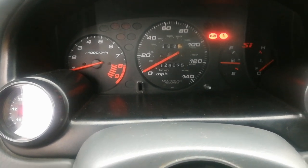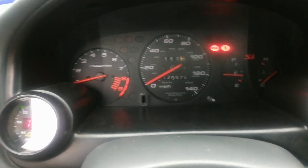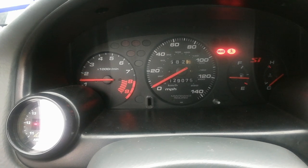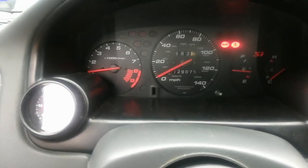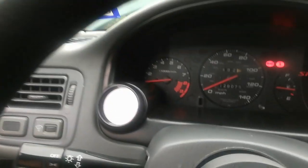Notice how now it drops down really fast. Let me get a little situated in here. I'm gonna tap the gas and it comes back really quick — well, quicker than it did before — and the idle is nice and low. It should be about a thousand. So I'm gonna go ahead and say that somehow the IAC was leaking past the gasket, or something wasn't aligned right.